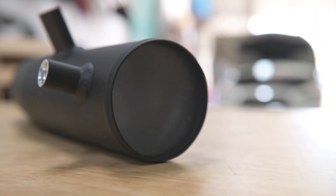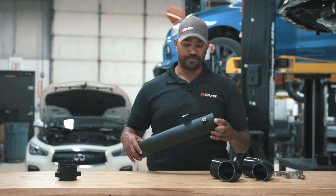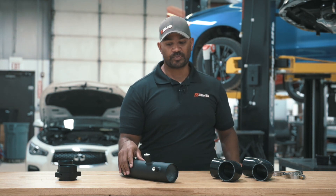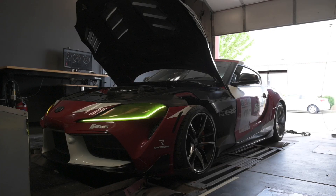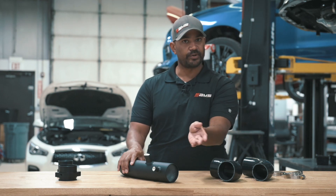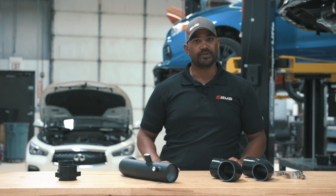This is a three inch aluminum — or as our friends across the pond might say, aluminium — tube. We did move the stock sensors a bit to help clear the engine cover, given the size of the charge pipe and its position. And we did test on the dyno to make sure that these actually read how they would from factory, especially the pressure sensor, because the geometry of the port inside relative to the flow going through is a little bit sensitive to the vertical positioning away from the center line.